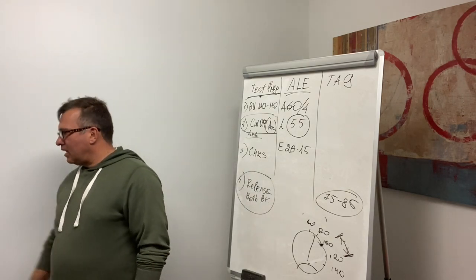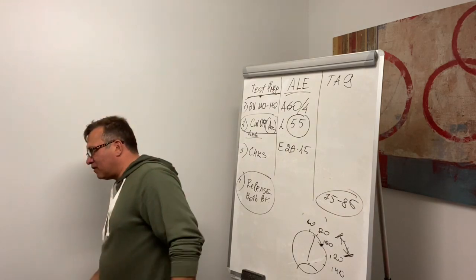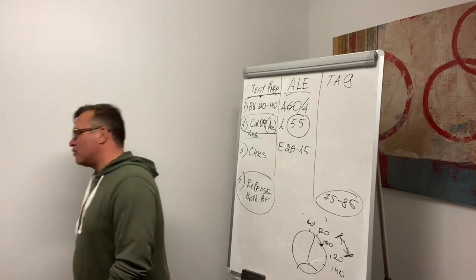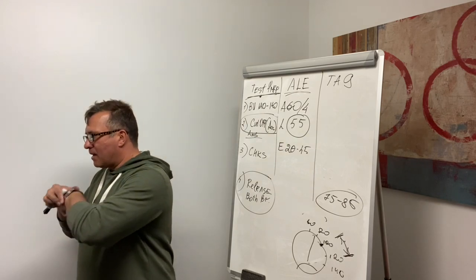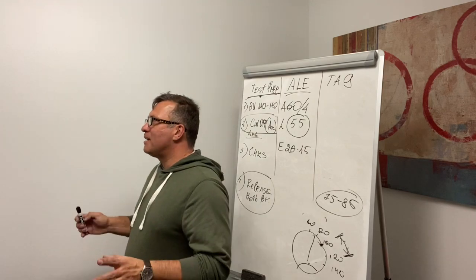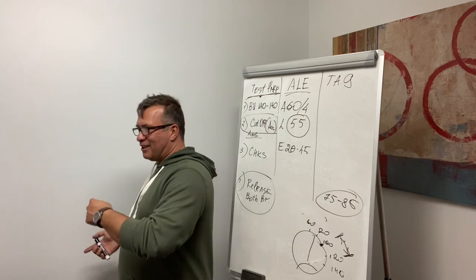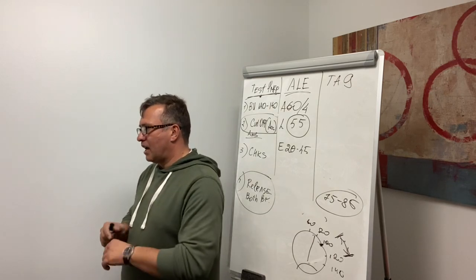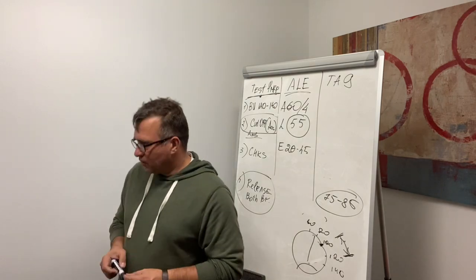Okay? And you will push it. Find the position, jam your foot between floor and pedal, so it will stay pushed. Don't release it the next minute. And remember, it must be a minute. I got a few guys who failed it by doing that, one of them pretended that it was a minute. He said he did 15 seconds, another one did 30 seconds. It's a minute, it's 60 seconds, okay? When you're timing yourself, 60 seconds always. Strong hold.